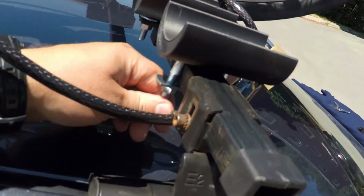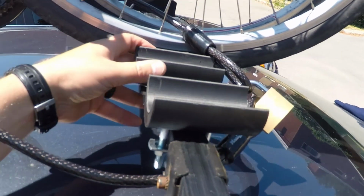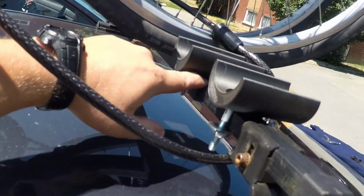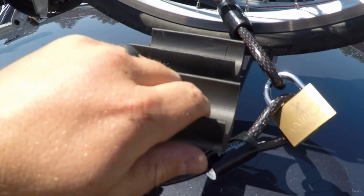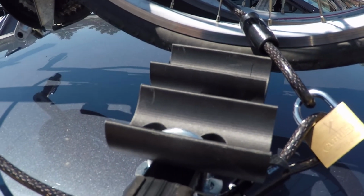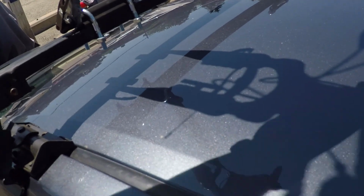However, right now I'm testing out a U-bolt design, or with the bracket, we'll see. Right now we're sliding, so I'm gonna get shims installed. We'll be good to go, and it'll stop. This one doesn't move, so a couple different designs we're going to test and adjust. And then moving to the front, look at the strength in the front. That's not moving, it's flexing the bar, it's tight. If I would have done that on that mount, like the static test, I probably would have broke it. So for all you designers out there, do a static test.